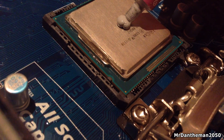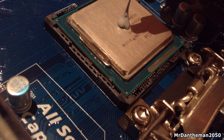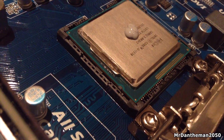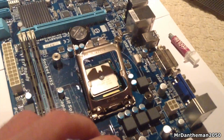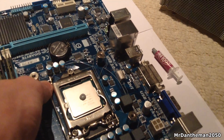As you apply your heat sink onto the CPU, it'll spread the paste out evenly, you'll have no bubbles, and that will be the way to go. As you guys know, thermal paste is there to help the dissipation of heat. You don't want too much because the heat will get trapped — what's the point of the heat sink then? And you don't want too thin a layer either, because then the heat can't transfer well to the copper of your heat sink.